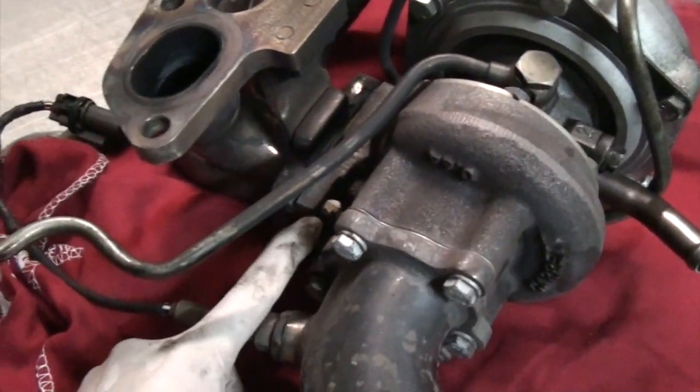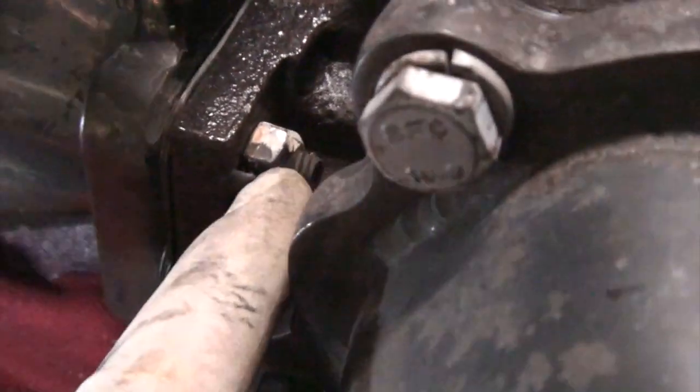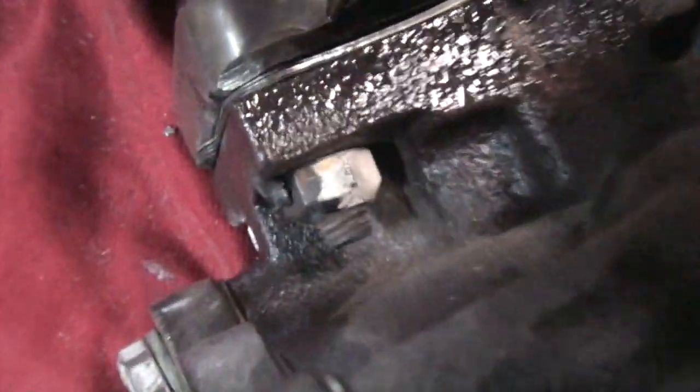So yep, gonna continue taking this guy apart. I'm gonna have to cut these spot welds, so it's not gonna be fun, but it is what it is. We're making some progress. I think the issue with these tack welds is that we might not have cleaned the nuts enough, because they're heat treated and probably coated in something, since it looks like the tack welds split off. Even when I was breaking these loose, I only had to grind down a hair, enough to get the wrench on there. They broke loose pretty easily, so I reckon they probably just wiggled themselves loose.